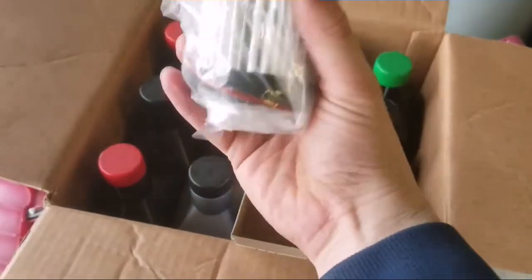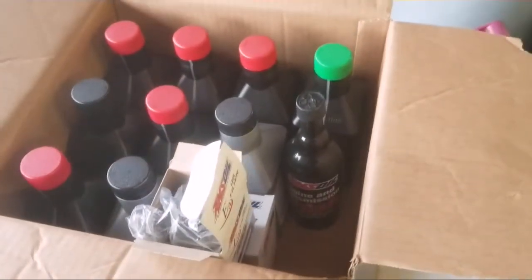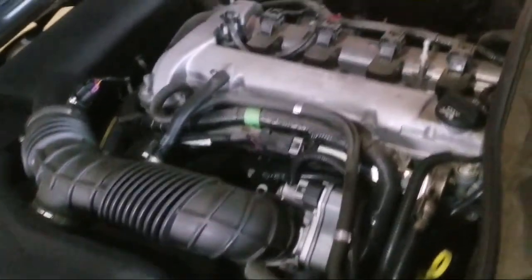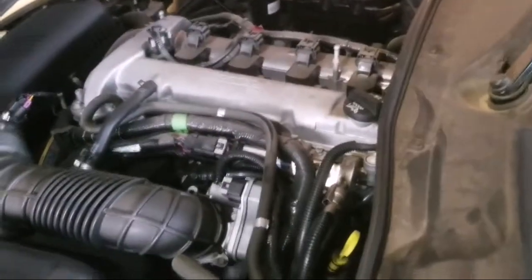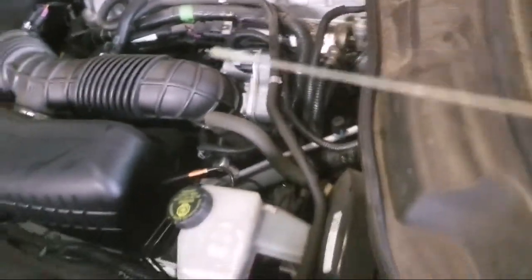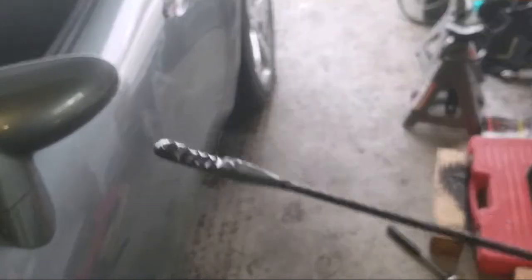It's got all your O-rings, it's got everything. I got the AMSOIL filter just so I can match the oil — that way I know they're both good quality. First things first, we're going to check and make sure there's actually oil in here and see how much there is. The cap of the engine just pops right off — really easy, no screws or anything. Dipstick is down here. It's not empty — it's right in the middle.